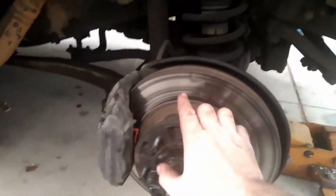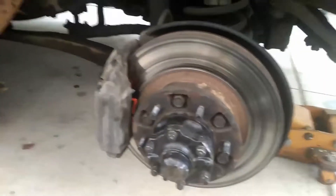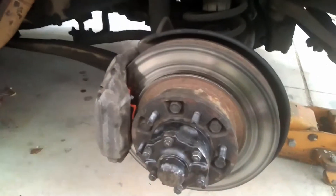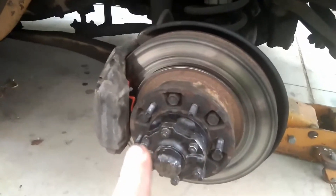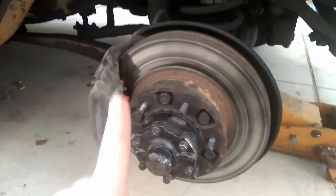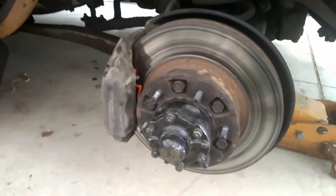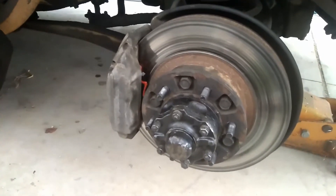So what I'm going to have to do is try and push the pistons back into the caliper for a bit. Now, the problem there is, obviously, I've got to re-pump the brakes up. The left side has bedded in perfectly, but there's still a problem on this right-hand side. It's a brake problem rather than a loose bearing or clunking noises — it only occurs when I put the brakes on. So I'm going to have to have a bit of a sticky beak at what's going on and try and see if I can't solve the problem because I need the car this morning.